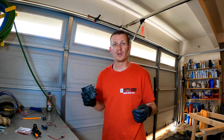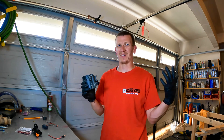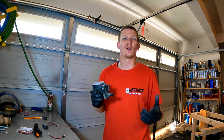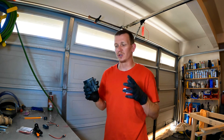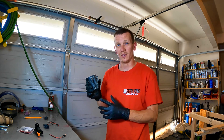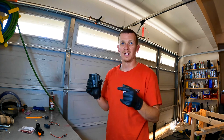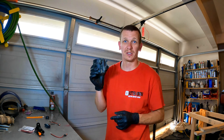If you need to know where your emissions vapor vent solenoid is, look for your vehicle in my video library — I have about 500 videos, a ton of which are emissions locations that show you where they're at and give you a starting point. You can test these on the vehicle; you probably can't blow into it while it's on the vehicle, but you can listen for the click.